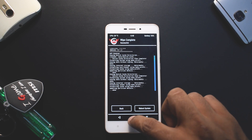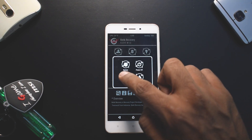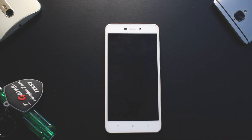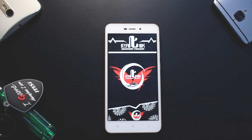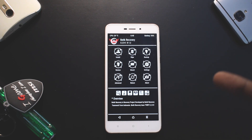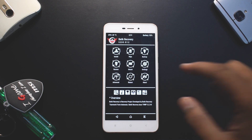Once the wipe is done, go to Reboot and tap Recovery, then swipe to reboot. At this point there is no ROM on the phone, so make sure everything is copied to your Micro SD. If you don't have an SD card, connect the phone to the computer and copy Pixel Experience to internal memory. There is no need for Google apps since they are pre-included in this ROM.